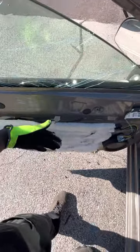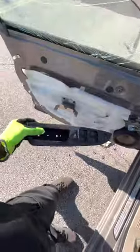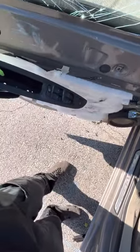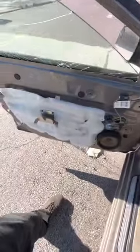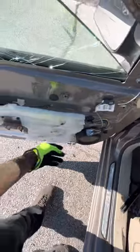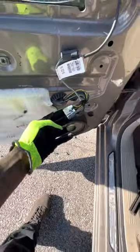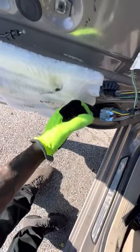After you get those two off, there's gonna be two little pop screws holding that door onto the face plate. You'll have to get this out in order to access it. To get this out, you pull it back up after you get those two bolts out, then lift it up and pull back this way. The connectors on the back are just simple push tabs. For this connector there are two tabs at the bottom and then a lever — you'll push that lever and it'll eject it.